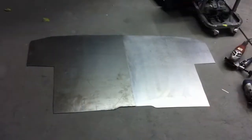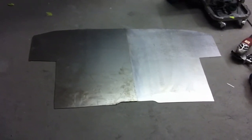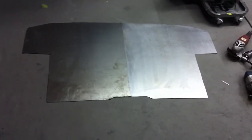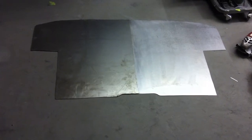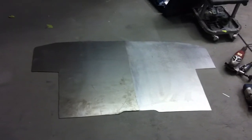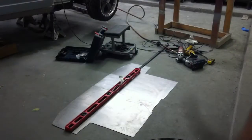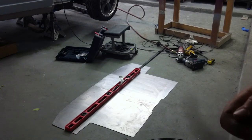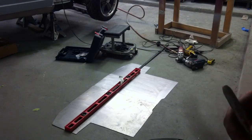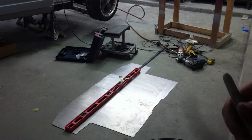There's our right and left pieces of our two-piece package tray laid out on the floor. We've got to go get them bent on a brake — we'll use James B's brake and get a perfect bend on it. You can see the relief in the bottom section here — that's for the trans tunnel, just to work around that. Pretty straightforward, easy little project and we should have it finished up by tomorrow night. We're going to draw a line to figure out how to get the brake laid out, putting both pieces together to get a consistent break across both pieces.